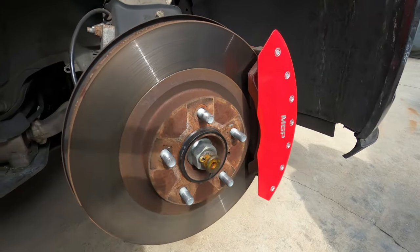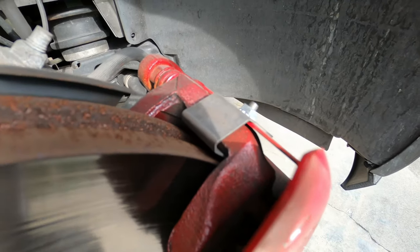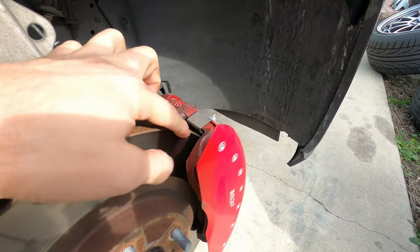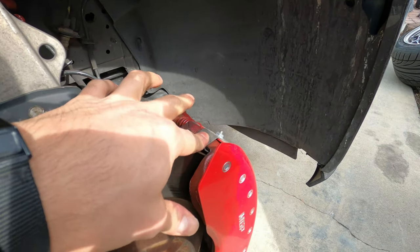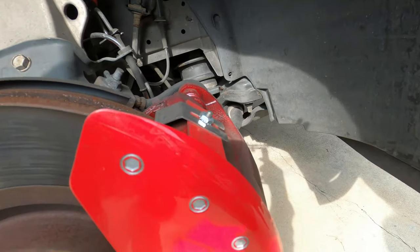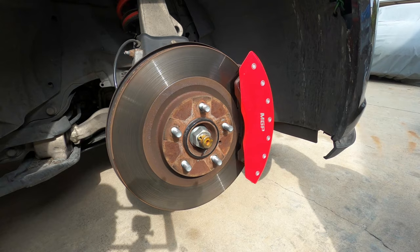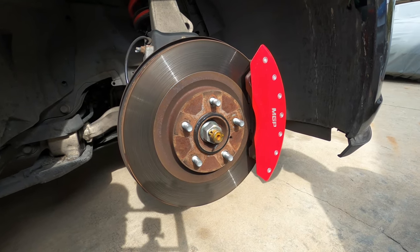In order to install them it's very straightforward. They come with these little brackets — you just have to hook them onto the stock caliper from the top and the bottom. Then it comes with a paper shim, which I believe was 0.3 millimeter, which you basically just stuff in to make sure that the rotor can rotate freely and not contact the cover, because that would cause some major issues. Once it rotates free, you just slide the caliper cover on and tighten it down. Make sure it's still rotating freely and you're done. Assuming you have all four wheels off already, the entire install is like 15 minutes — really a piece of cake. If you have to do one wheel at a time it'll take longer, but it's still a pretty quick install.